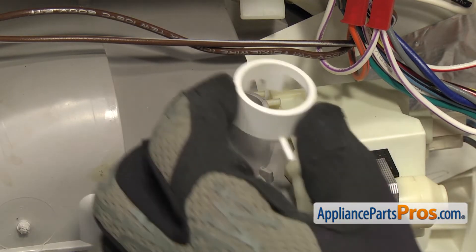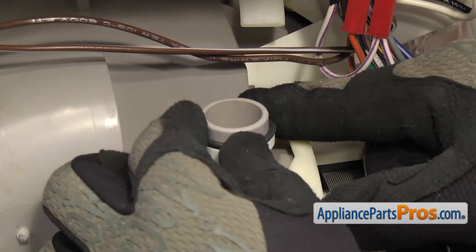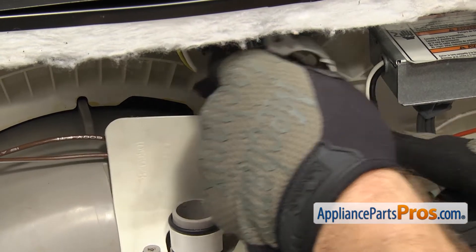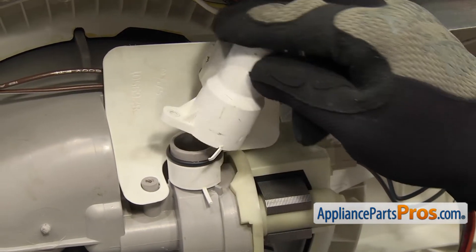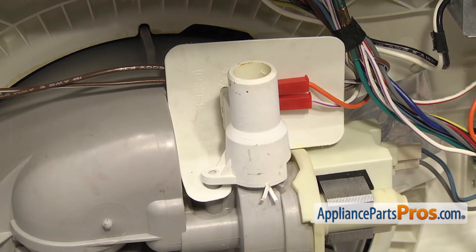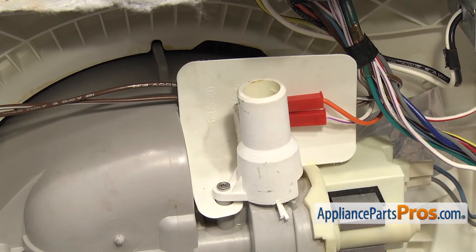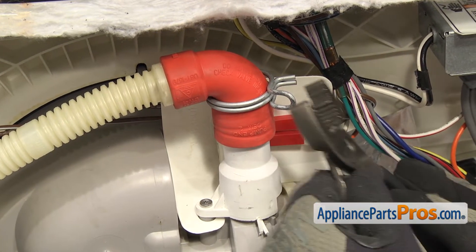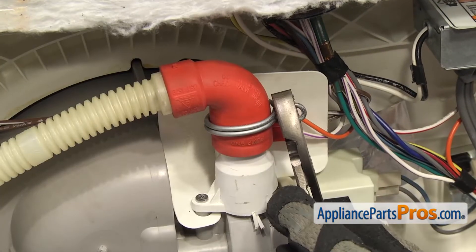To put the fitting on, we're just going to lower it onto the sump. Once you have it in place, we can put the o-ring on. Once you have the o-ring on, we can put the shield on — all you have to do is set it into place. Then we can grab the top half of the fitting and push it down onto it. To make it easier to get this on, you can get the o-ring wet and inside the housing wet — it'll make it easier to slide down. Once you have it on, we can use the Torx 15 driver to put the screw in. Now we can grab the drain hose and put it onto the fitting. Once you have it started, we can use the pliers to compress the clamp and press the hose all the way down on the fitting. Then move the clamp all the way down so we get a good seal.